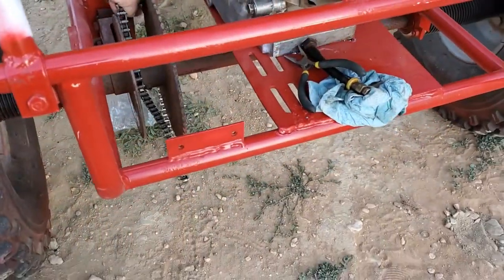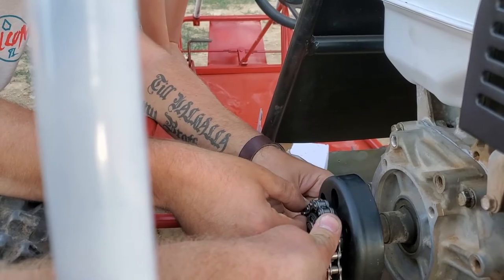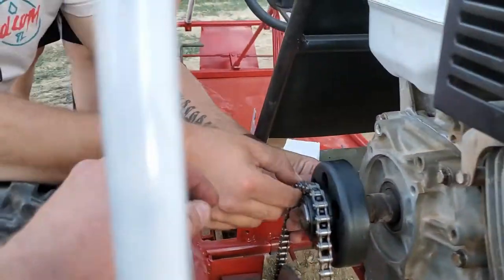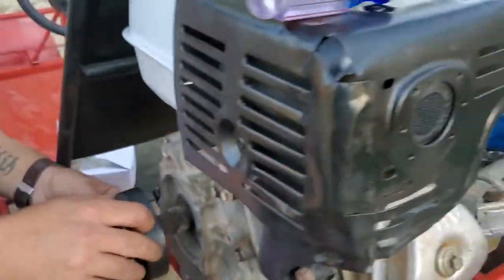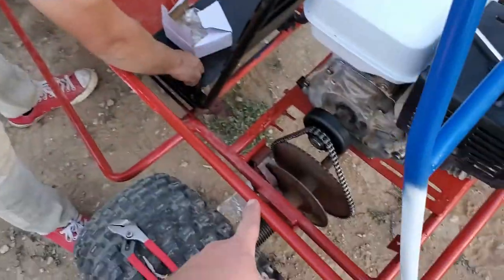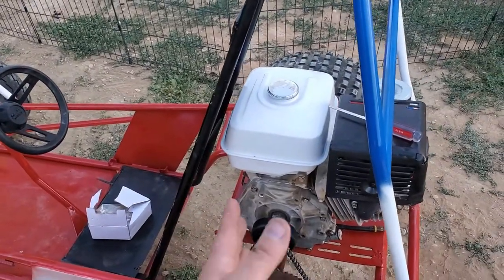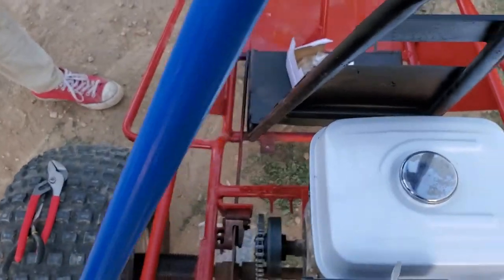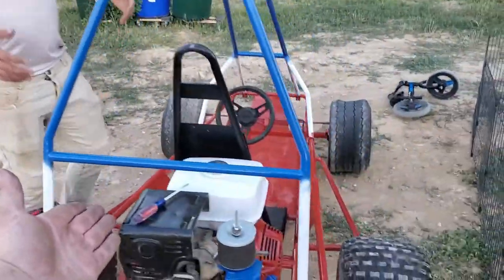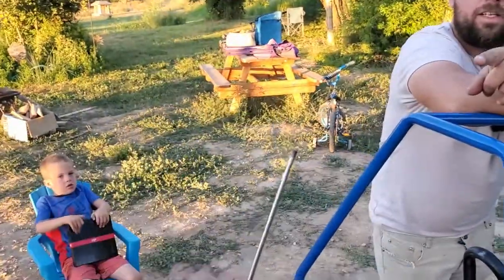If it's a little loose that's fine - we can slide the motor forward and backwards to make it work. It looks like it's going to be tight, barely enough for one master link. We'll try it and let you know. Check it out - that sucker is tight. It will stretch - it's not pre-stretched, but it will stretch some. The chain lines up perfectly with the sprocket - looks nice and straight. The screaming eagle, the all-American bald eagle is gonna be flying here in a second. We just need a throttle.